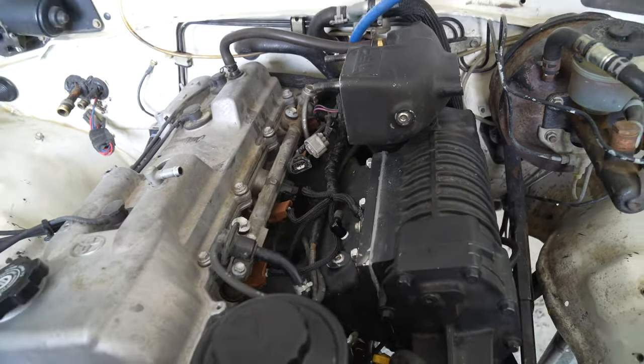So we ended up not having a tight coolant line on the throttle body. Not a big deal. I'll just go ahead and put a hose clamp on it that's already on it, and it's set. But that's just a reminder. Check before you drive.